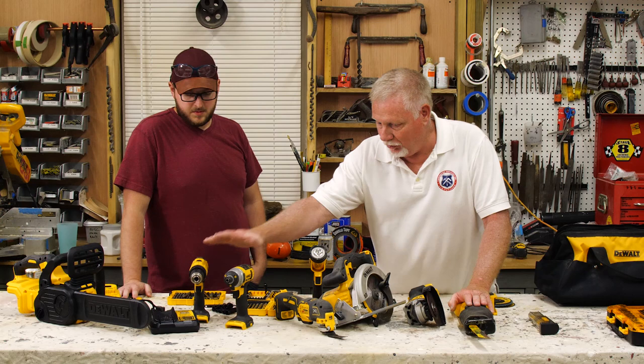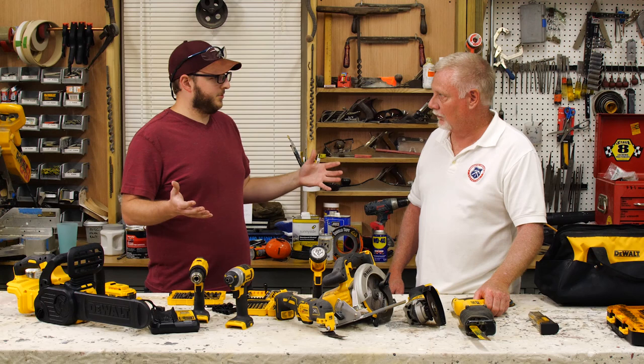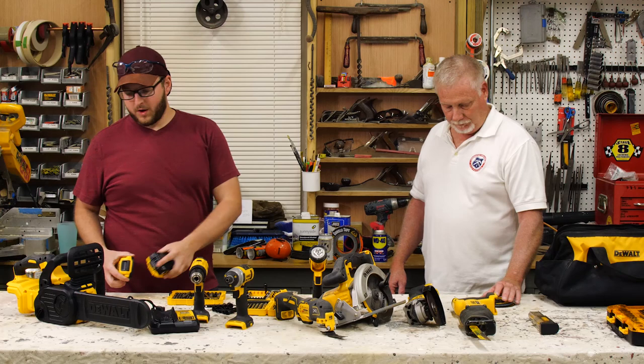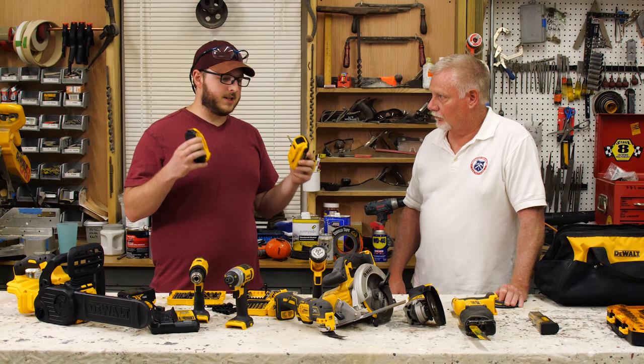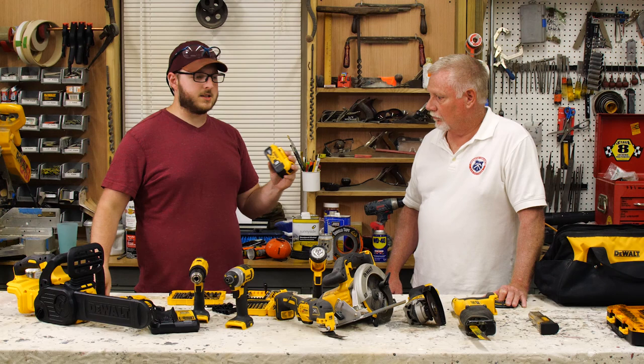If you're doing a heavier job, you do need hardwired tools. When we were working on some hot summer days, those two amp-hour batteries would not go a long distance when you're grinding off seat bolts. I would definitely recommend picking up extra larger amp-hour batteries ahead of whatever project you're going to be tackling — they're just going to come in handy.